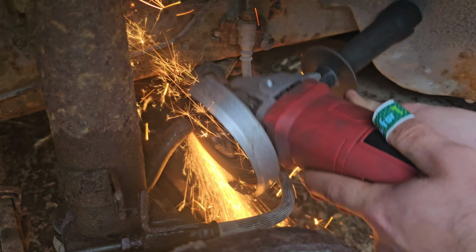And then the next thing we're going to do here is this whole wiring harness. We're going to unplug everything and we're going to run it through here. You can tell, this is a pinch point. If you get hit with one hit here and clip these wires, you're going to be down for the count. So through the firewall there, right above it, right in here, we're going to cut a hole. Basically, we're going to take all this wiring and run it up through there and then just plug in what we have to just to make this thing run. So let's start doing that and see what we can do.